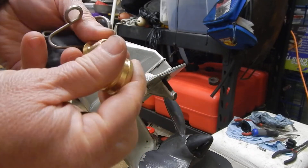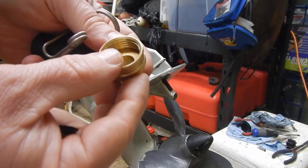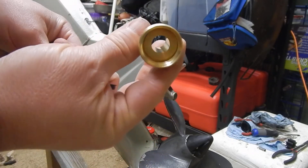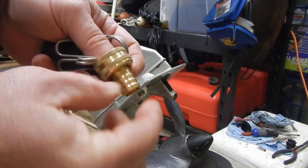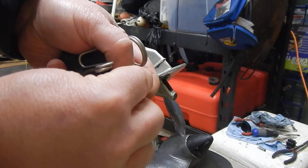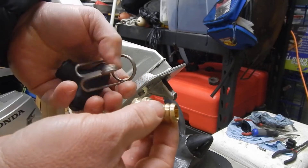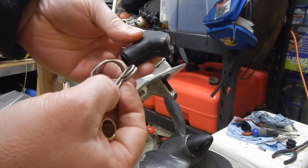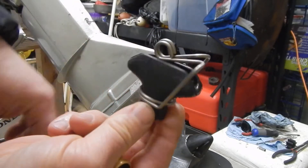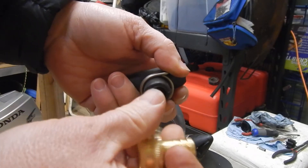The garden hose piece is probably the easiest — the brass male fitting just slips inside the female and then you have your standard garden hose fitting. There's a little rubber gasket supplied with the kit, and this does disassemble pretty easily. Next, you just want to slip the clip over the rubber water jacket inlet adapter.